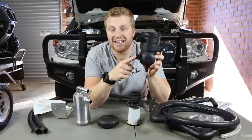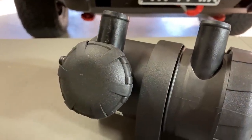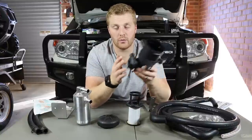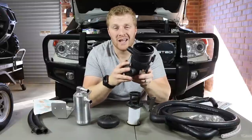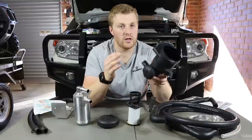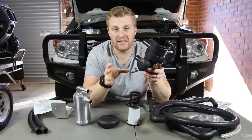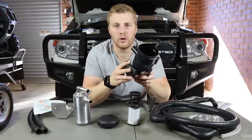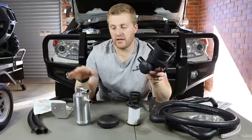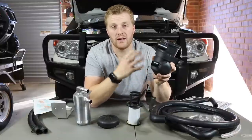Clean gases come out of the lower section, and on the side there's a PCV or pressure control valve. This is essentially a one-way valve that manages the pressure from both the crankcase and the vacuum and pressure from the intake system. On these Land Cruisers we have a closed-circuit crankcase ventilation system, so you've got to account for vacuum and pressure from the intake side as well as from the crankcase, which varies depending on throttle response — whether you're idling, at full throttle, or decelerating. This pressure control valve manages pressure from both the crankcase and the intake system and ensures it's suitable across the engine's full RPM range. That's something the HPD doesn't have — it's just a straight-through system passing through mesh gauze — so this adds safety, reliability, and longevity to the unit and to your engine.